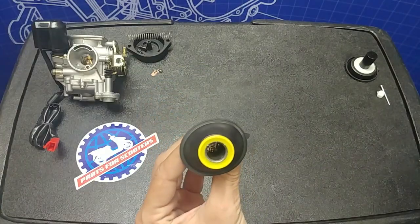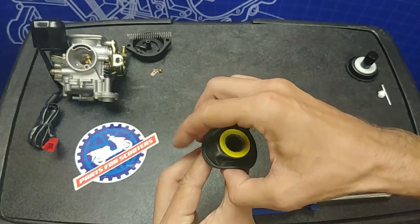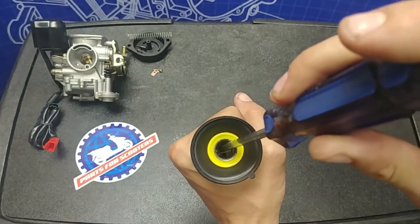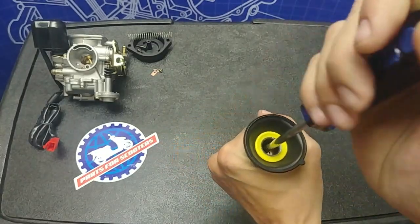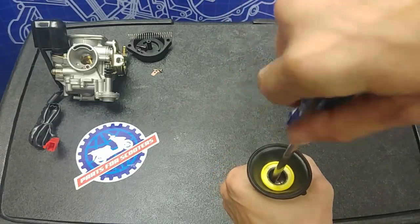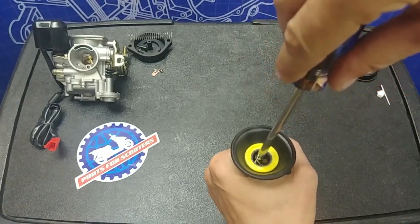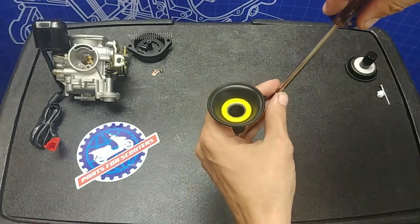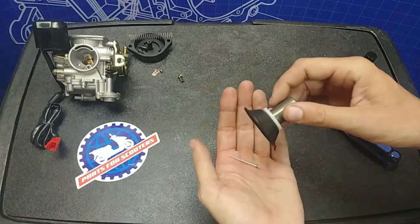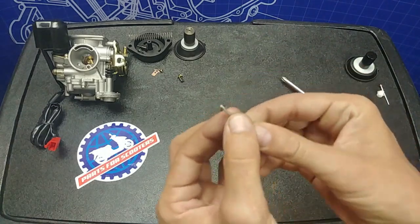Today we'll be working with the one held in with the screw and plate. What I first do is pull the diaphragm gently up and out of the way of the slide. Now you can get your hand firmly around that slide to get your screwdriver down in there and break that screw free. Sometimes these are really tight, sometimes they break free easily. If you have a magnetic screwdriver the screw and plate should come up with it; if not, you'll be able to dump it out in your hand. Set the diaphragm off to the side in a clean spot and now we are left with the needle.